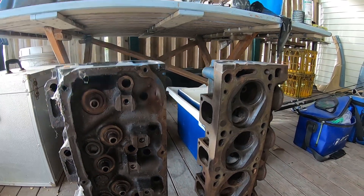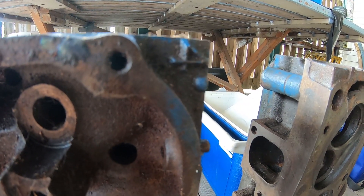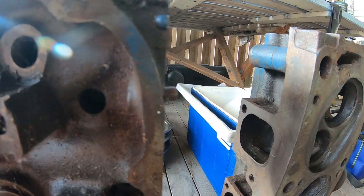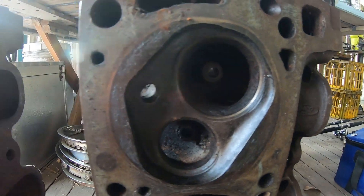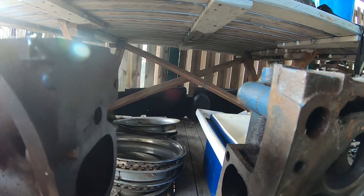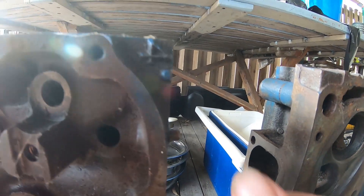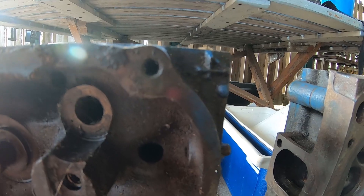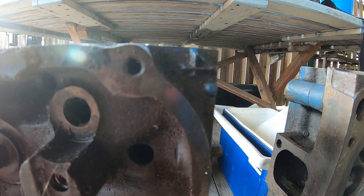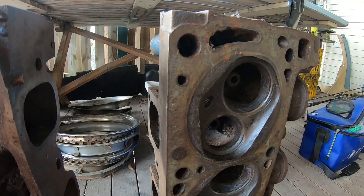What we're looking at here — there's a little bit of glare, trying to get a better angle — these are four V four dot closed chamber heads. A lot of people online say you see the four dot and it automatically makes it a closed chamber. No it doesn't guys — it's the size of the dot. This is a small dot, and I have another set of heads which I'll work into the video showing four V four dot open chamber.